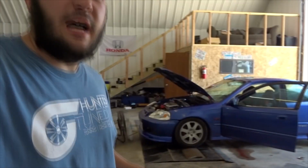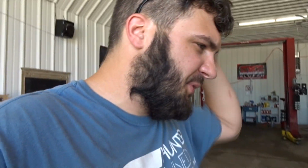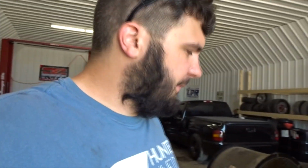That first pull that we ended up doing, I got out of it because it went like 12.30 air fuel, and I wanted to splash a little bit more fuel in it. When it came into the higher boost range is when it went a little leaner, so I had to adjust the fuel map accordingly. The pull when we got out of it made 173 horsepower and 249 foot-pounds of torque. Revving it to 4 grand and getting out of it, it's already making almost the same amount of power that it was all motor.